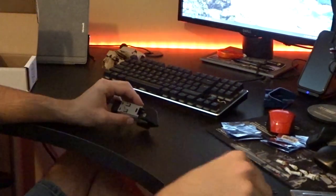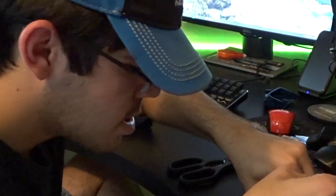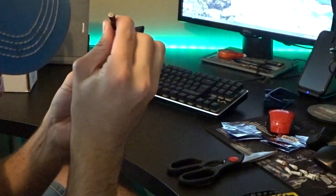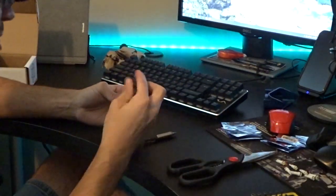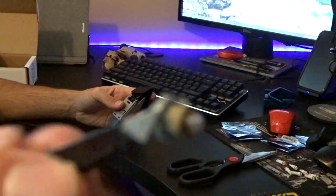Get the other switch out of its bezel. You'll want to take this time to clean or paint your bezels — I have mine painted blue. For the aux light switch, you need a little flat head screwdriver. Go in on the bottom of these and twist them — they should come right out. You may have to use a pair of tweezers to get in there and grab hold of it and yank it out. That's what comes out: a little incandescent bulb.